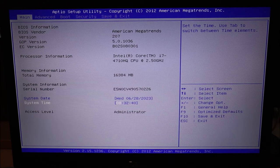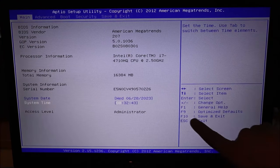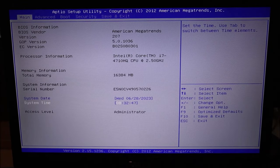If the date and time is wrong, change it, then save and exit — my key says F10 save and exit. Restart your computer; if that fixes the problem, great. If not, come back into BIOS and check again. If your date and time settings are still wrong after saving — meaning they didn't keep — that could mean your CMOS battery is dead. That's the component that keeps power to your motherboard and BIOS even when the computer is off to maintain settings. If settings are lost after every shutdown, your BIOS is losing power and resetting all settings. If you have to change your date and time every time, replace your CMOS battery.